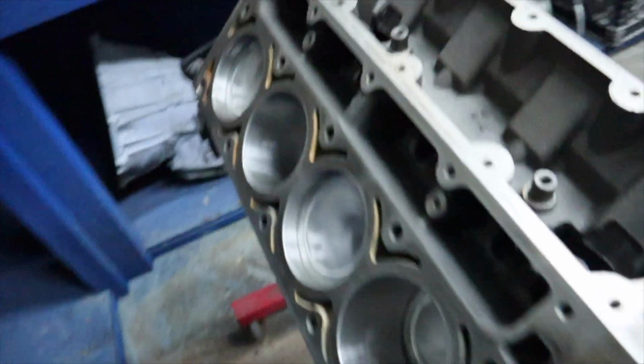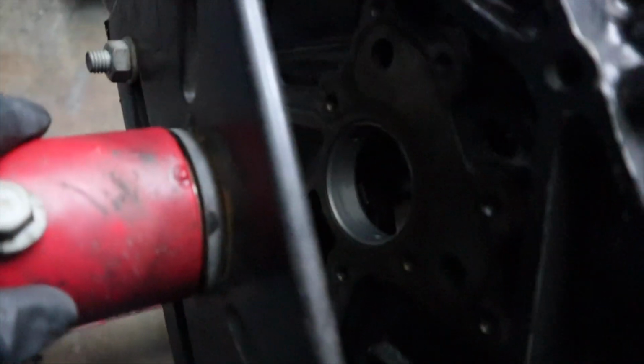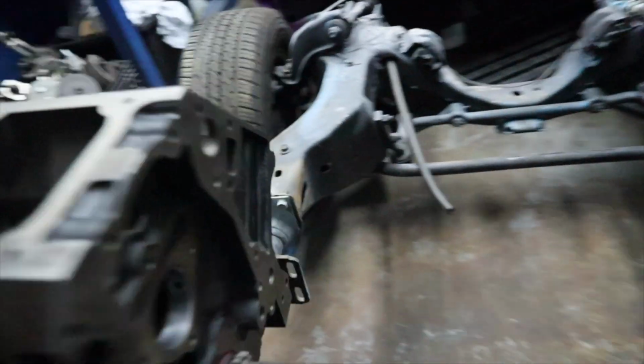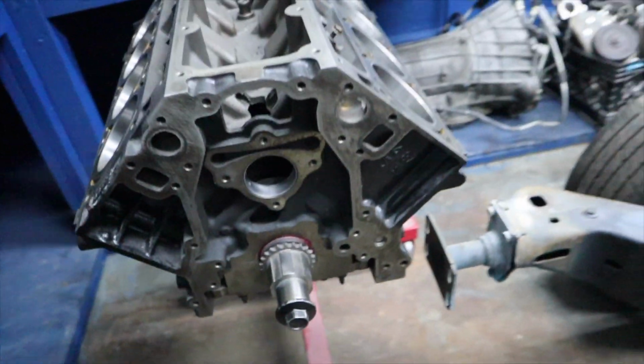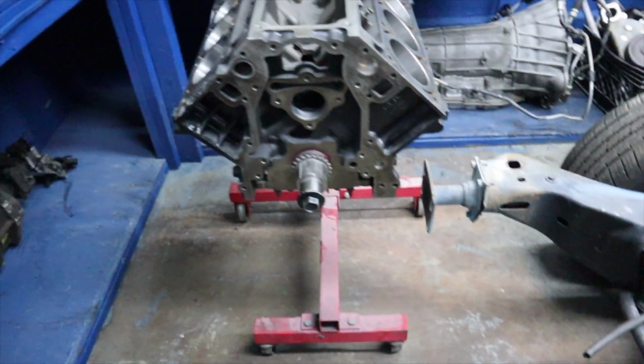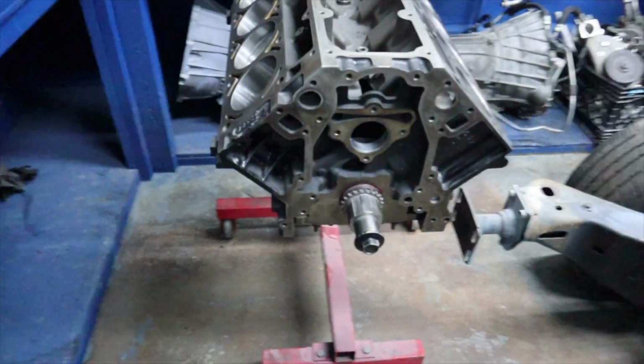So basically today what we're going to do is install the majority of the gaskets, as you see in the back. No gaskets here. That's one thing Johnny be messing up on. When you start assembling your LSs, there's this little oil dumbbell you gotta put in. Did he put it in the front? All right, yeah, we're good for the front. But there's this dumbbell that you guys cannot forget. You would not get no oil without that thing.